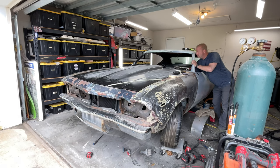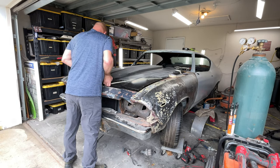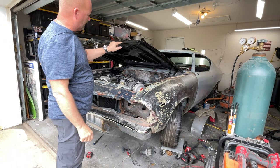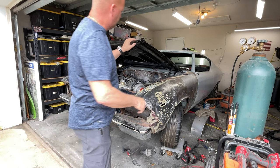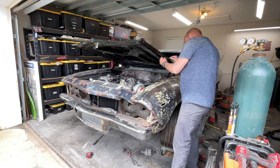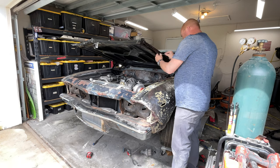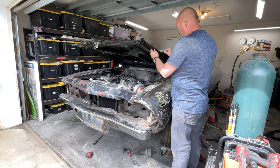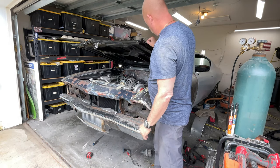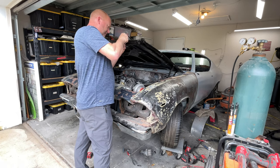All right, how do I do it? Let's check it out. I have to drill out these spot welds past where it is. You've got to let the metal bend - I bent the corner but it just wasn't quite enough. So I'm going to have to drill all these out. First you want to use your center punch. Just going to go through and do all of these - it's kind of a pain. My neighbor's driving by - some of them like me, some of them don't.